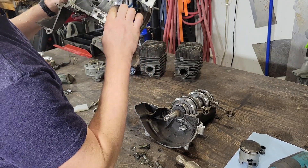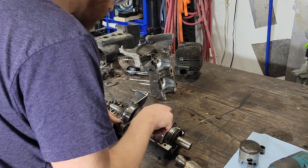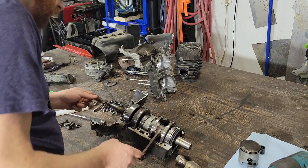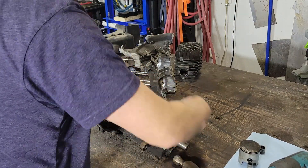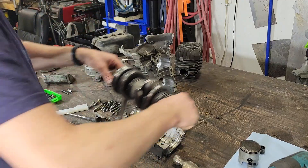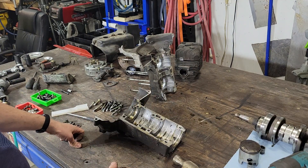The crank surfaces look okay, so that's nice. Crank looks decent — everything feels good there. I'd say it was time for a change on these oil seals — crankshaft seals — so I think it was a good thing. There's some schmutz in the bottom here, so I think we'll be glad that we clean this up. The next step is to clean up everything, get a gasket kit, and come back and put it back together.